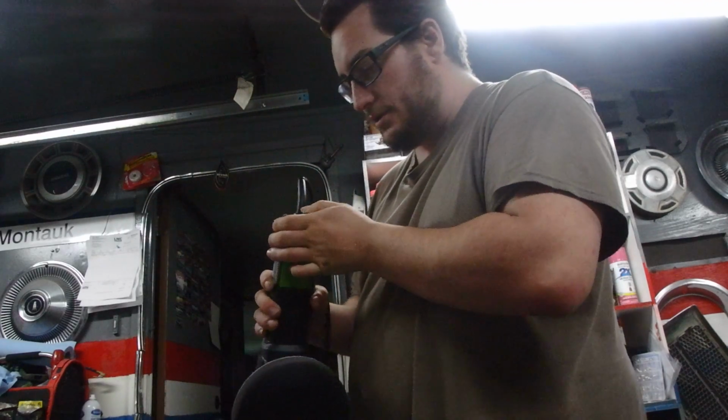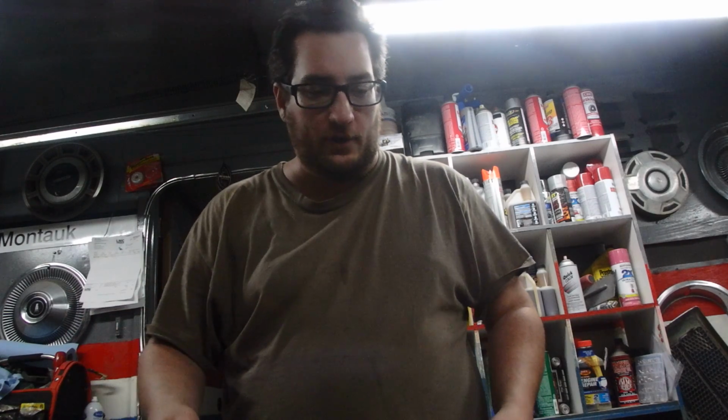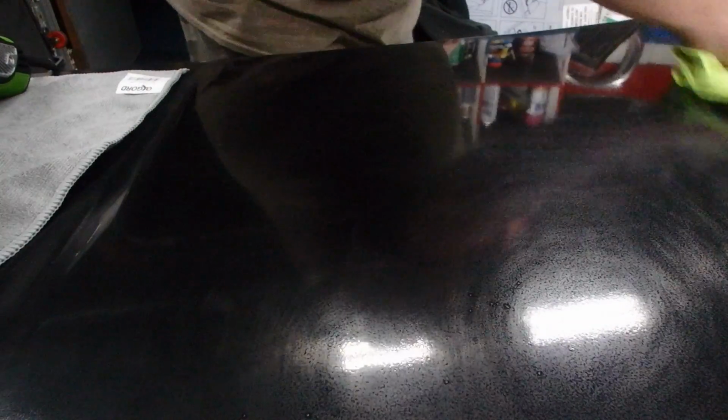On the bottom here is the speed selector. Now I saw online that people are talking about between 4 and 5,000 RPMs. The one I was using from Ryobi, I looked online, it said like 4,600 RPMs is where it sits. So we're going to do 4.5, because that's where people are talking about the polish is really the best. And I'm going to smooth it out on the surface. So I'm going to smooth out the polish in this general location, and from there, I'm just going to go to town and hopefully the camera doesn't fly off the handles here.